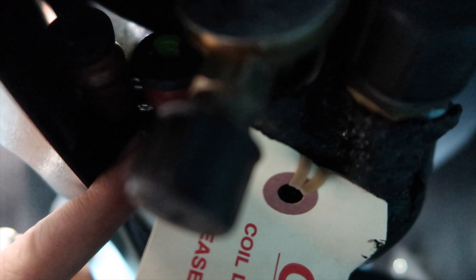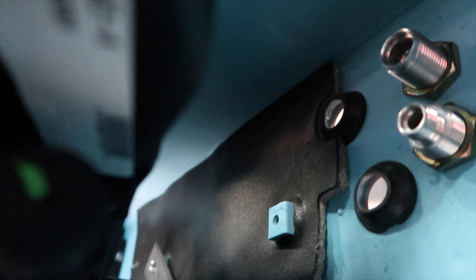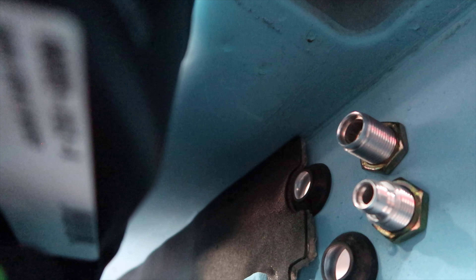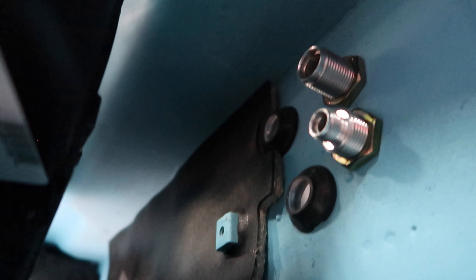This is the backside of the car. You can see the two fittings coming out of there — those are going to plug into these two right here. I'm currently out of the correct fittings; I'm going to need to get those to connect. Also, if you notice these two copper reddish-looking ones down here, those are the heater hoses. I'm going to have to get those to come out through here, up and around, and then through the firewall where the two grommets are. I'll use the stock heater hoses and probably use some sort of adapter down here.